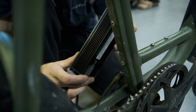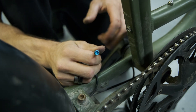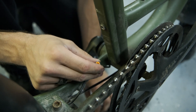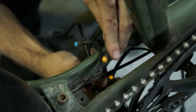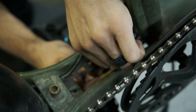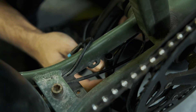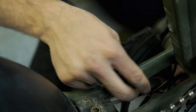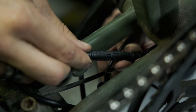Now we're going to mount the controller. We're going to mount it underneath the frame, but first we're going to plug in everything. This blue plug is the original rear brake light — we're not going to do this now because we're doing the light upgrade in the next video. Here's our pedal assist sensor, which is the orange one. We have the battery removed right now just for ease of visibility and access, but the battery plug will also plug in. This one is obviously the battery plug, and the harness plug is this one right here — we'll align the arrows and plug that in.